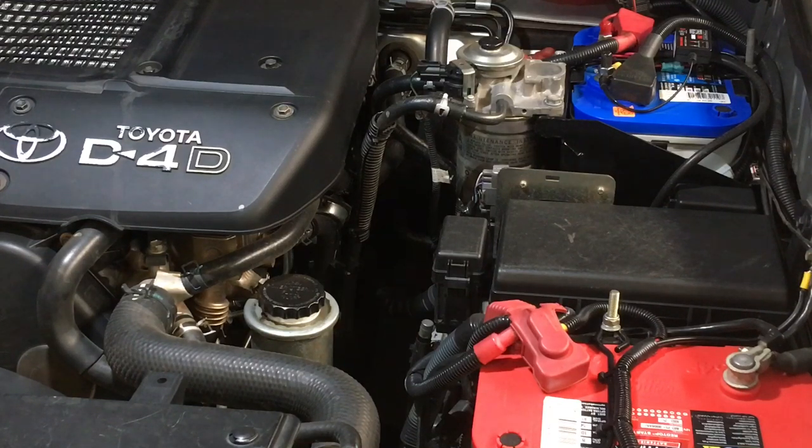The way the fridge works: it has an evaporator inside — that's the cold part — and a condenser outside — that's the hot part where heat is dispersed by airflow via a fan. If you've got a fridge built into a box with no airflow, efficiency drops and the compressor runs forever because it never reaches the set temperature. Running it on freezer isn't ideal either. Less is more — small fridges, less power, better results.